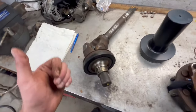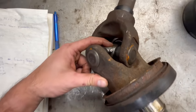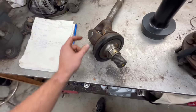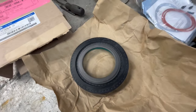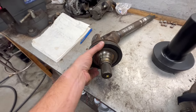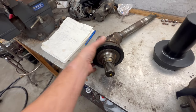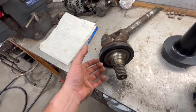Just to give you a little bit of background here - we done the U-joints, which are brand new from Ford, so they should last the rest of the truck. I haven't got the vacuum seal off yet, which is this new one right here. This one just comes off. This is for the vacuum side of your auto four-wheel drive. Without this, it wouldn't be able to keep a vacuum, which keeps your four-wheel drive engaged.